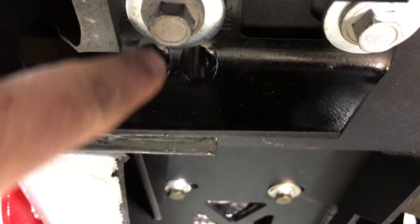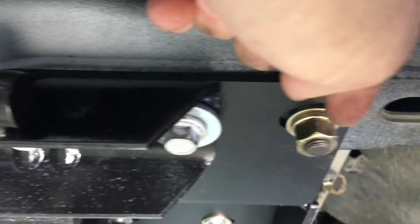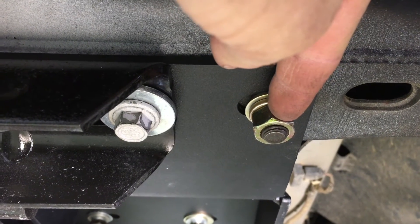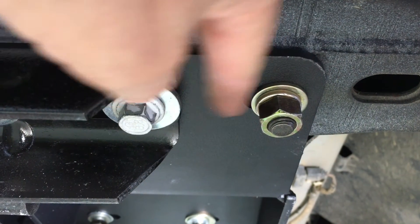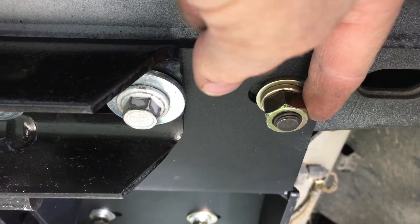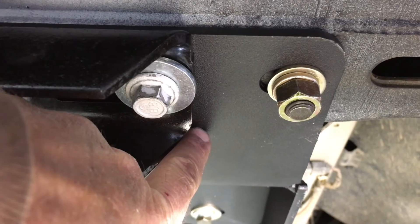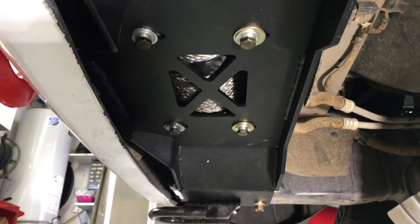The two factory bolts are here and here. This bolt hole wasn't in the frame, so I just took a plasma cutter and cut that hole real quick, then dropped in the bolt that came with the winch plate — it has a little ear on there so when you tighten it up it doesn't spin. It was very simple: I mocked up and installed this plate, marked my hole, took it back off, punched the two holes one on each side, and bolted it all back up.